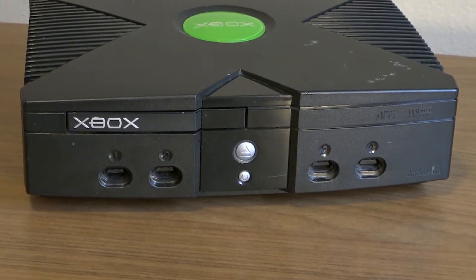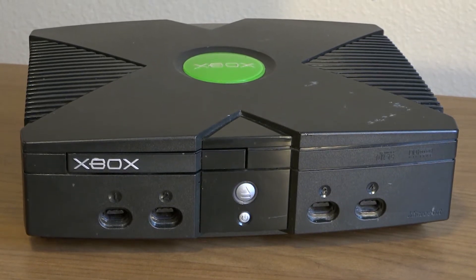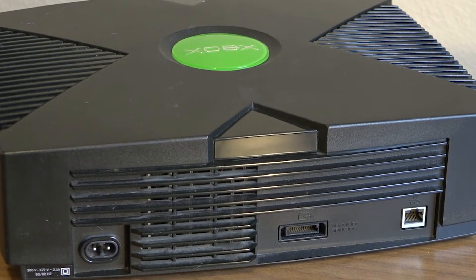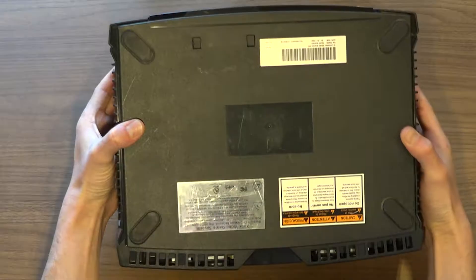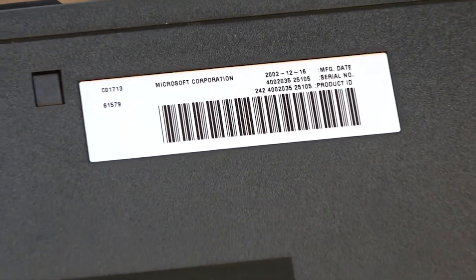No tech knowledge? Afraid of opening electronics? Assuming this video is over your head because I said tech and knowledge — this video is for you. There were 8 versions of the Xbox released. Versions 1.0 to 1.5 need to be fixed. If you have version 1.6 or 1.6b, you do not need to perform this repair. You can see what version you have on the underside of the console by the serial number. Look at the last 5 digits. If the number begins anywhere between 20 and 33, you will need to perform this fix.